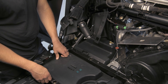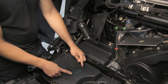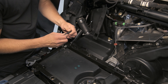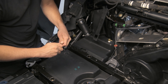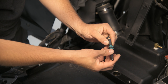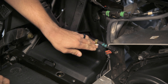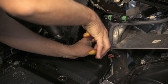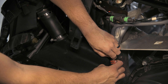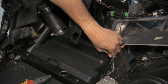After you get the fuel tank installed, we're going to adapt the EVAP line to our rollover valve. To do that, we have in the kit these two clamps, a little piece of hose, and a barb-to-Bundy connector. We're going to put the hose on the Bundy connector, then put on the clamp, put on the other clamp, and slide it over the barb. Adjust the clamp and go ahead and insert it into the EVAP line. Make sure it's fully inserted, lock it down, and you're done.